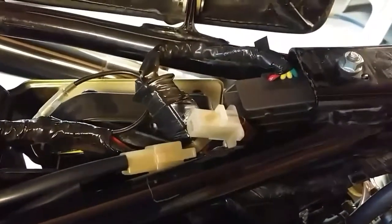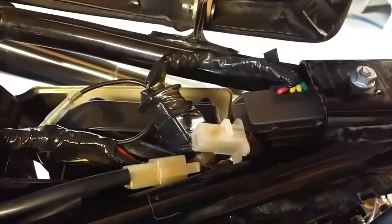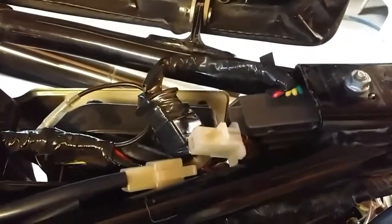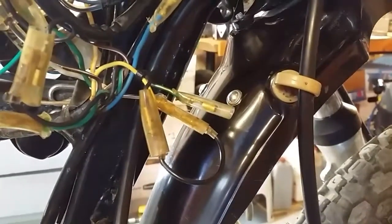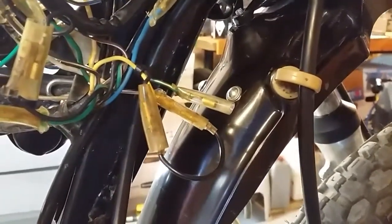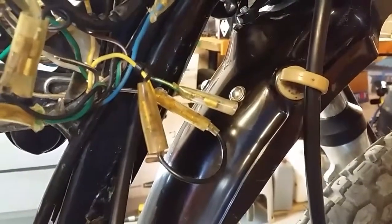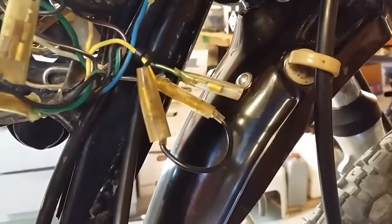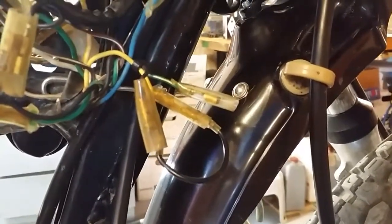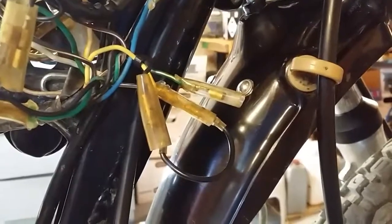This combination unit is designed specifically for these Hondas, and it was about $20 with free shipping and plugged right in — I couldn't believe it. So far it works great. I've tested it while riding and it's keeping the voltage at no more than 6.4 to 6.5 volts. One very important note: when you replace the DC regulator and rectifier with the combined unit under the seat, where you have three wires going to the old regulator, put a jumper between the yellow and the black wire. You can see I've got a little black jumper here. The green wire — actually green with a white stripe — is redundant and doesn't need to be connected to anything.